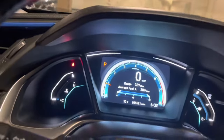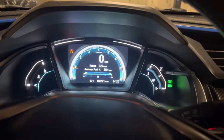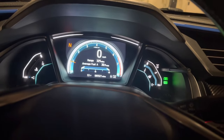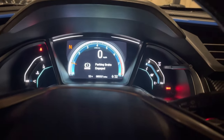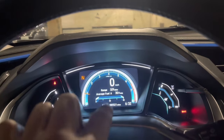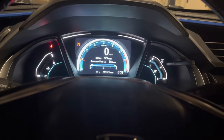You can see my seatbelt light is still on. Press the brake hold button — it's going to activate — and you'll see it in the dashboard. Then put your gear into neutral. Remove your seatbelt after you put it in neutral, and then press the brake hold button. You can actually hear it — I don't know if the camera picks it up — but my brake engages and it shows in the dashboard. That means my e-brake motor is still working. When I release this button, it releases the brake.